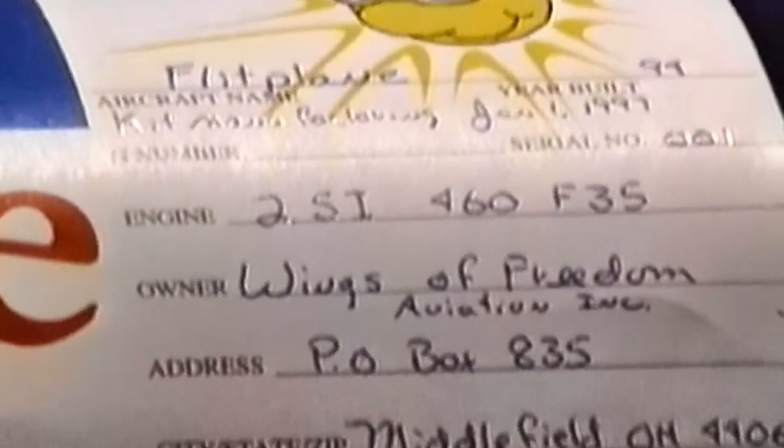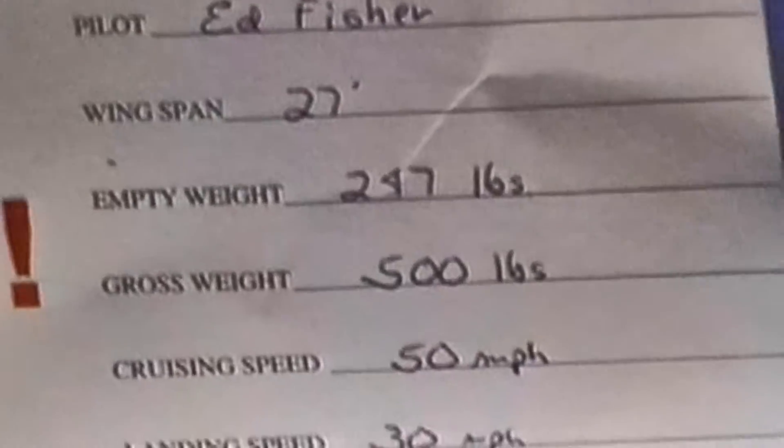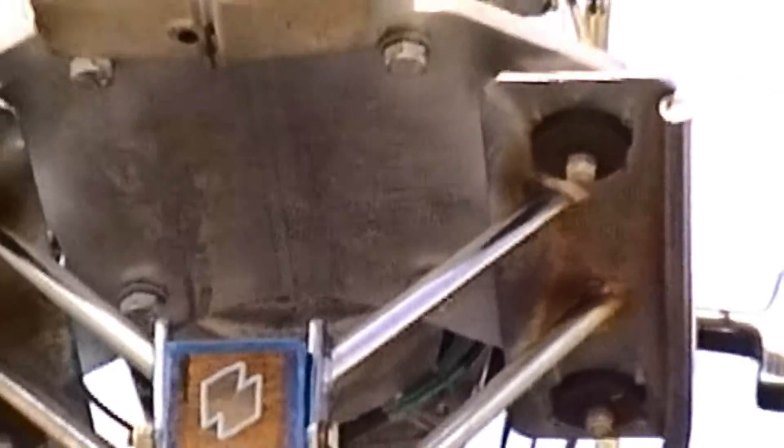What kind of control systems are you using on it? We have a three-axis control system set up with ailerons, no flaps, because we have a six-foot chord tapered to a four-foot wing. We feel the full operating ailerons — full wing ailerons — is working really well for us.